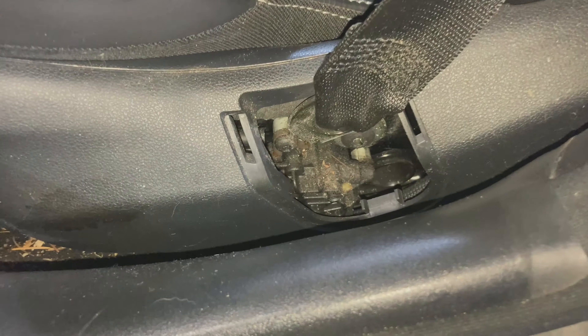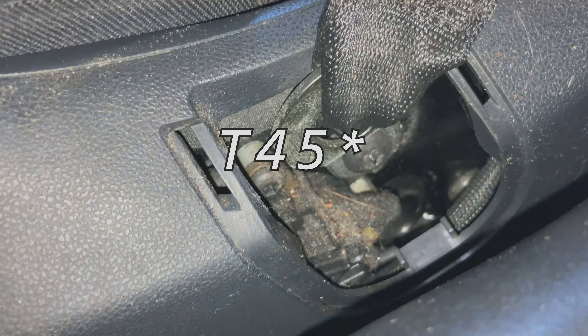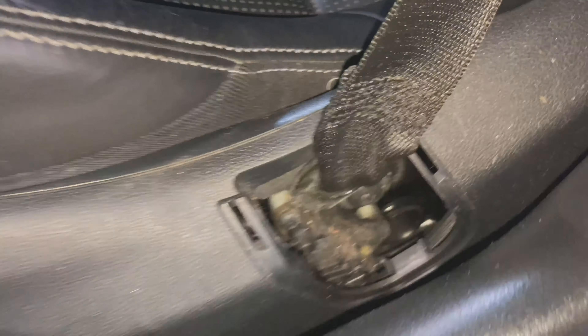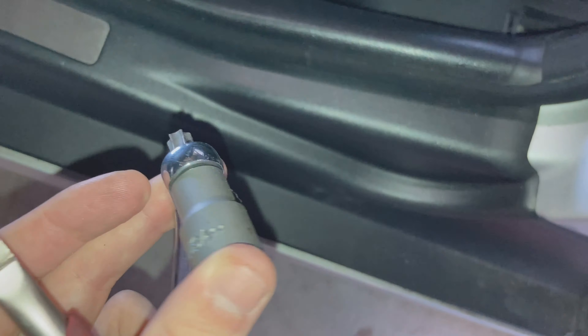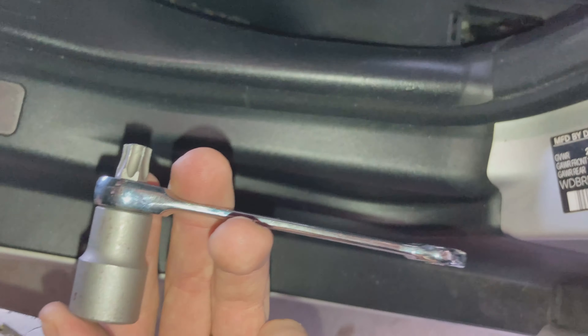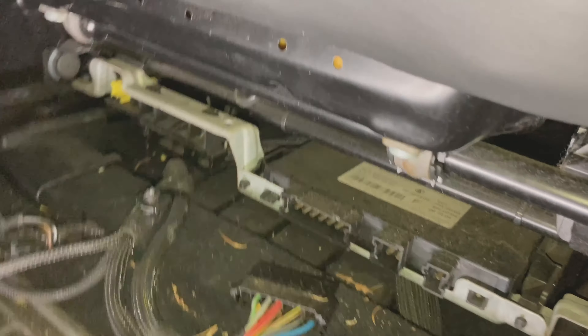The bolt in here was actually a T-45. I used just a wrench on it because it wouldn't fit in there with an actual ratchet. I put an eight-millimeter wrench around the head and it wasn't on there tight at all — I put an extra wrench on for leverage and it broke loose super easy. You could probably get it off with just the one wrench. I'll try it on the passenger side.